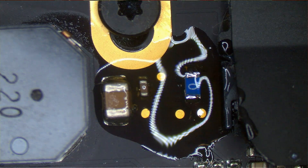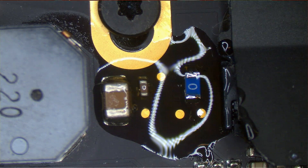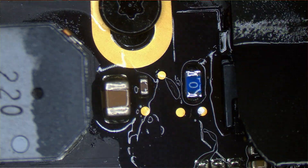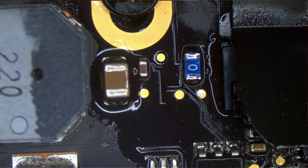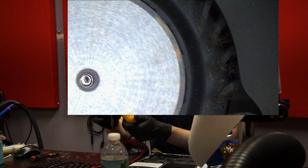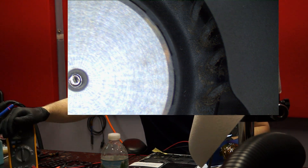This board was left for me — somebody replaced the screen yesterday and said the assembly killed the backlight on the motherboard. This is also a good time to go over how to tell if that's actually true. On this Retina, if you look at the schematic, we're going to check for a short to ground on the backlight pin of the LCD connector. The backlight pin is pin one, which provides backlight voltage. I'll change the view so you can see the multimeter.